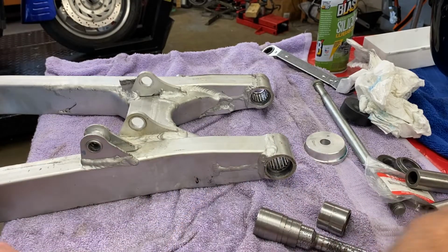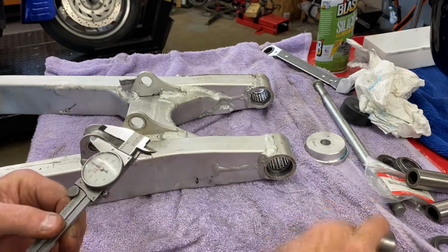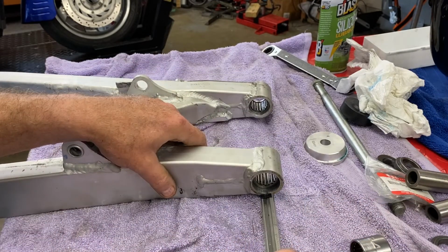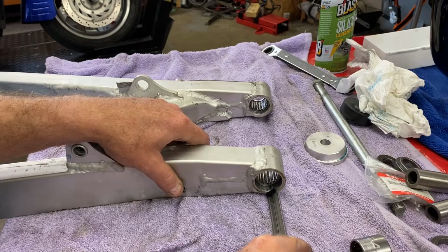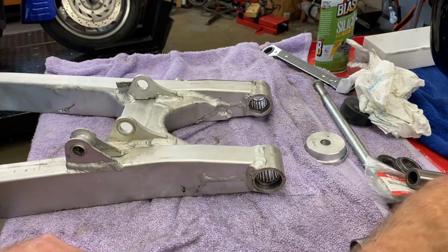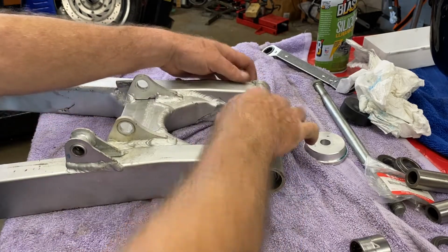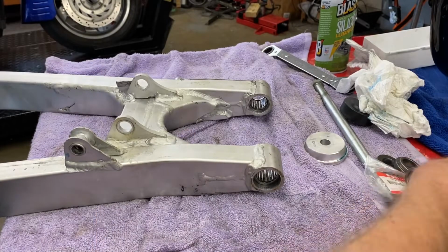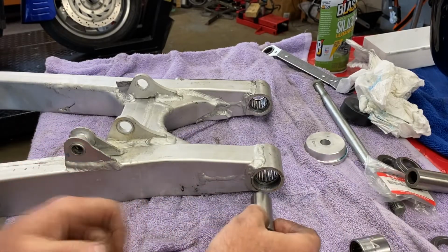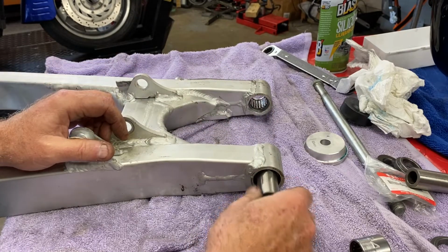Push them down to about halfway, which, according to my calculations, is about 0.350. That was a little lower than that, but actually it's a little more proud than that. It's okay. It's close enough, as long as they're about in the center, which they are. This one maybe, yeah, doesn't matter. We're good, because these things are going to be just fine. Normally, as I said before, they ride more toward the outside the way I found them. So now we got that.